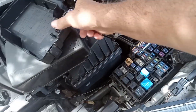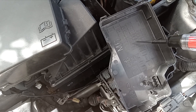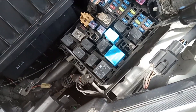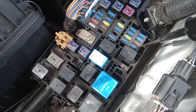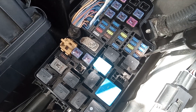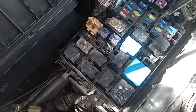So the first place to come and test whether something is not working is the fuse box. On the back of the fuse box you have a diagram with abbreviations of what each fuse is for. For example, this is a 15-amp fuse — notice that the fuse has two contacts on each end, and that is what allows you to test it.